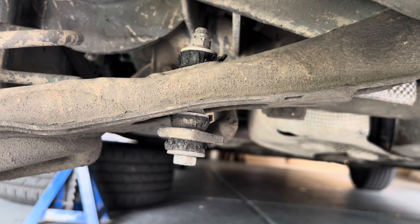We've already removed the wheels and the car is lifted. Make sure you're in a nice level space where the car is not going to move. Make sure you chock up the wheels so that if there's any movement, you prevent the vehicle from moving forward or falling.